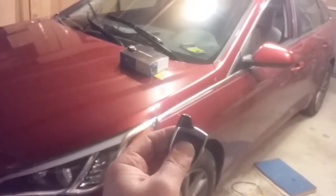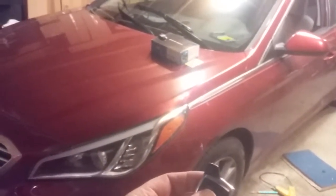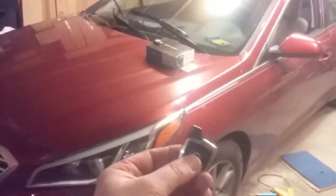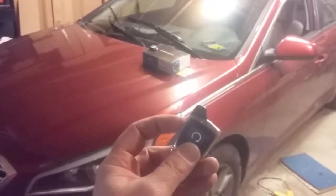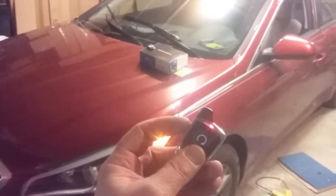This will be twice to start. It's a two-way remote so you hear it beep back. Parking lights come on, starts. Within about four or five seconds, the parking lights will come back on. It'll send a signal back to the remote that it's started — beep — and the flashing light, parking lights come on.